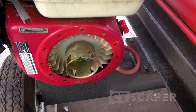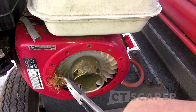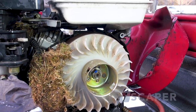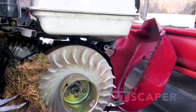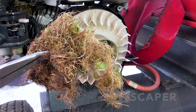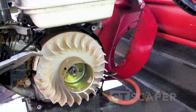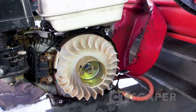If you look over here and start grabbing with some pliers, there is still nest in there. I think the best solution would be a blowgun for this one. I wouldn't be surprised if there's a mouse in here too. There were four little bolts to take off this shroud — the shroud pops right off — and this is what was hanging out underneath. There was no way I was going to get that out, even with an air gun. So now we can just grab our pliers — hope it doesn't squeak at us. Look at that. Now I can get in there with my blower and blow this all out, but look at how much damage they did to this flywheel. They nibbled this whole corner away, and I thought I was going to get away with not getting a new one. I'll have to go find the model and serial number and go to my dealer and see if I can find one.